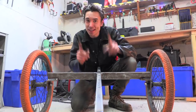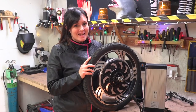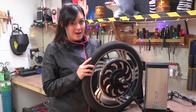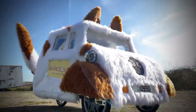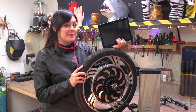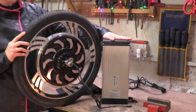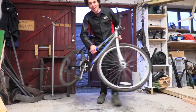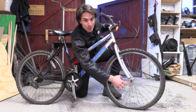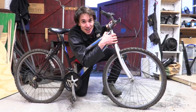For the rear wheels on Isaac's mega sleigh we've got these old BMX wheels that we are reusing from our cake gravity racer that we built. Most sleighs don't have wheels, but we're making our sleigh electric, so we've got this electric hub motor which is one of the spare wheels from when we made our furry giant electric dog car. The cool thing about this is you can connect it to a tablet using Bluetooth so it shows you how fast you're going. We're going to power all of this using our rechargeable battery. We've got an old scrap bike and we're going to cut off the front forks and mount our electric hub motor wheel in there — that's going to be our steering and how we're going to power Santa's electric sleigh.